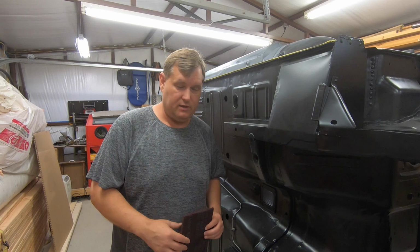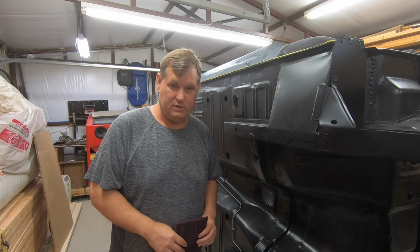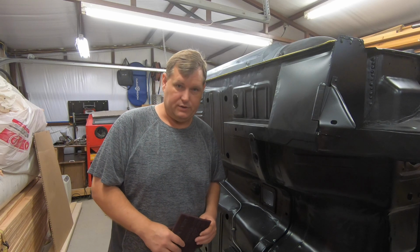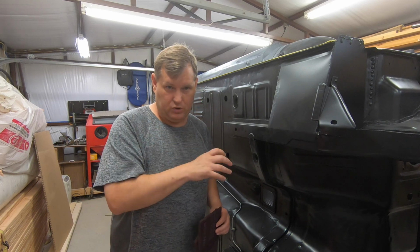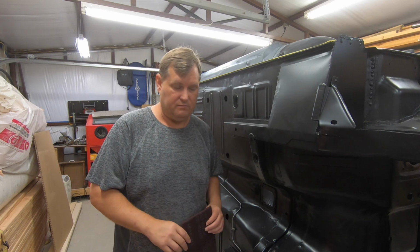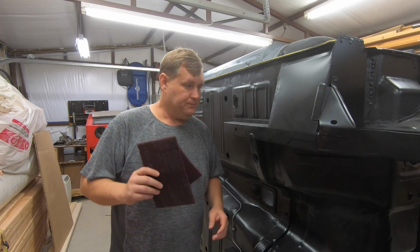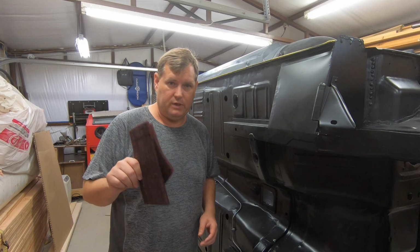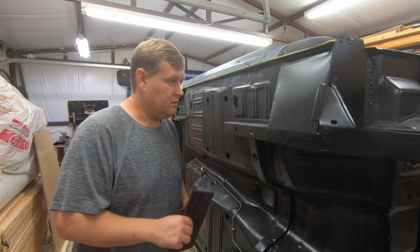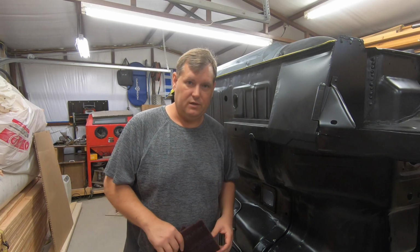But I would say, get some pipe, get a bender and a flaring tool, make your own lines. Unless you're just going for the exact original type of weird master cylinders and stuff like that, then go for it. So I'm going to put that on a time-lapse-y kind of thing, and I'm going to get started on scruffing this down and masking it off.